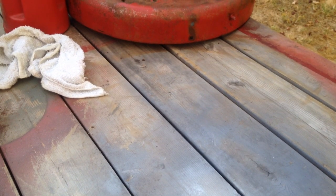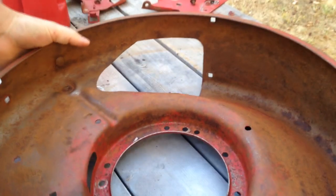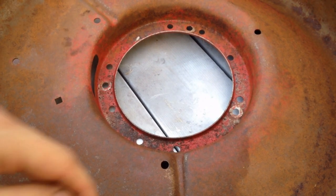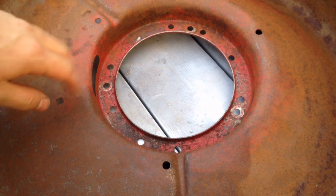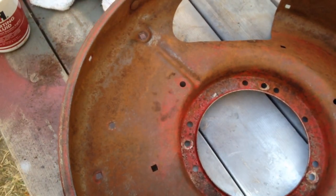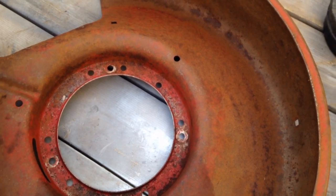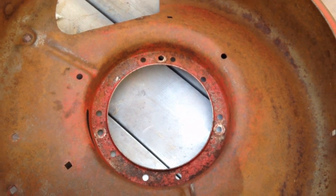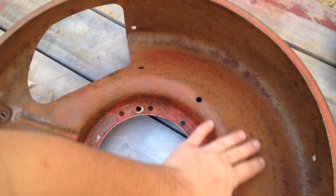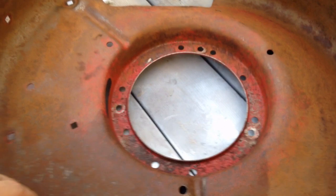The main focus today is gonna be under here. This is after I went over it with a wire wheel and pressure washed it. Now I'm gonna come in with some sandpaper and just give it a quick once-over, and then after that we'll come in and give it a couple coats of primer. It's still actually pretty cool this morning — about like 55 degrees, which is so nice compared to those 70-degree mornings. We'll prep this, wait for it to get a little bit warmer, and give it a coat of paint.